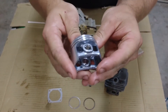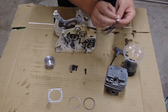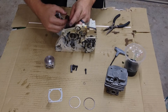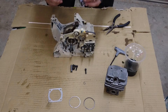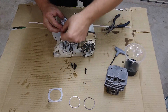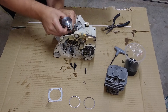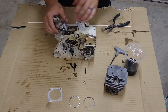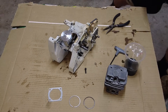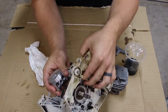It's in now. I have the opening facing upwards. I have some two-stroke oil here and I'm just going to lube up the wrist pin very generously. That just slides in and then we'll make sure the arrow is pointing towards the exhaust. Slide this over and the wrist pin will slide through. Wrist pin is in. Now we'll insert our last circlip here and I'm going to put a rag down under here just in case anything drops.